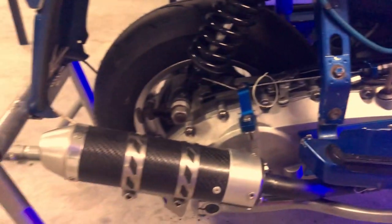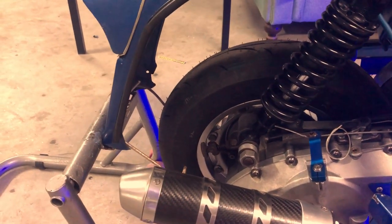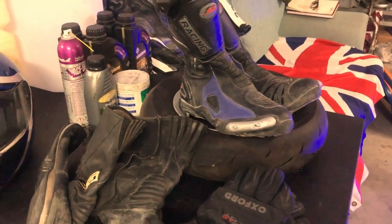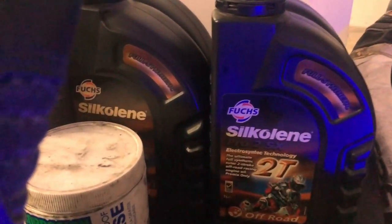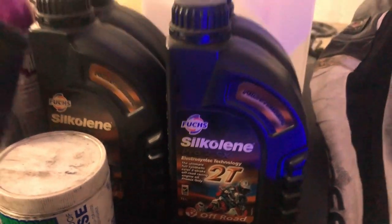We're running a radial head and my fiberglass covers - as you can see it's cut away here for extra cooling over the cylinder head. Nothing super special. We've got Mitas tires on there - I'm running a medium on the back and soft on the front. I've got a spare soft for the back if I need it, so I'm carrying an extra spare soft tire. Hopefully we don't have any rain because our wets would have to be changed over and we don't have any more wheel rims. We've got the fast fill for the tanks and oil - I'm running the Silkolene Pro 2SX, seems to do the trick, good enough for me.